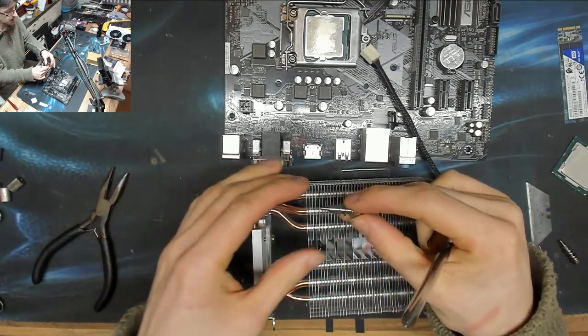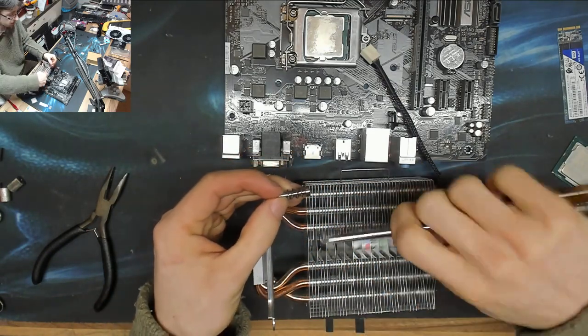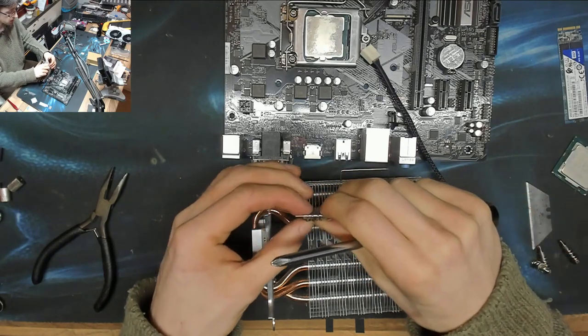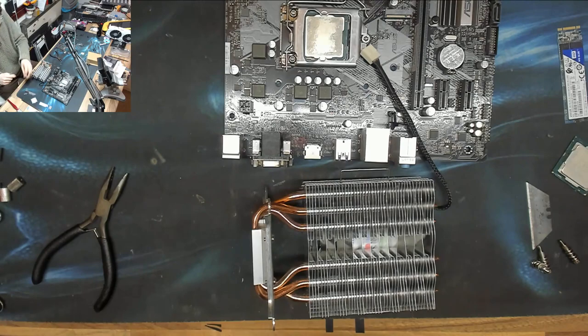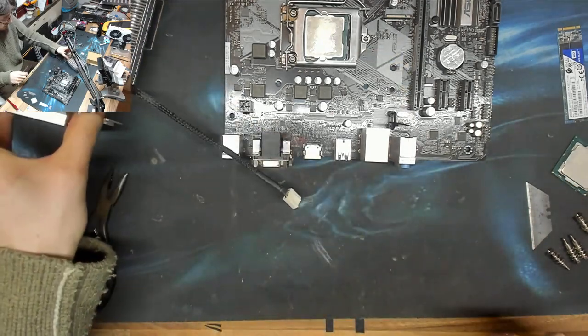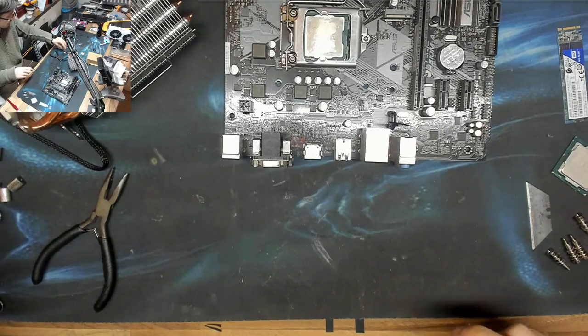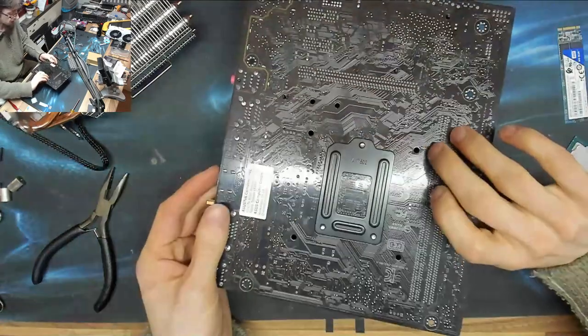All you've got to do is wind it down to the stop. And that's it. You don't have to tighten it. You don't have to graunch it up tight. Literally, just take it down to the bite point, and that compression screw will do all of the work for you. That's all you have to do. It's not a car. It's not going to get shaken down the road at 100 miles an hour. It doesn't need to be bone-achingly tight.